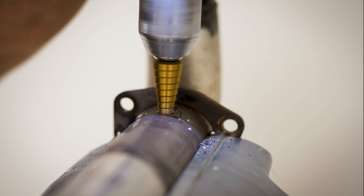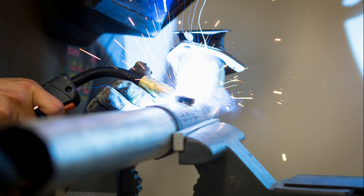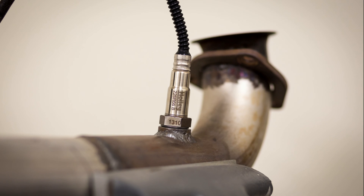Step 1 is to find a suitable place to mount an O2 sensor, which will feed back the air-fuel ratio (AFR) to the ECU. Really not difficult at all with the right tools. If you don't have access to a welder, this is a simple job for a muffler shop or fabricator and shouldn't cost much at all.